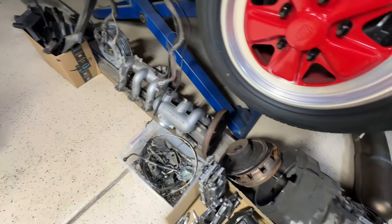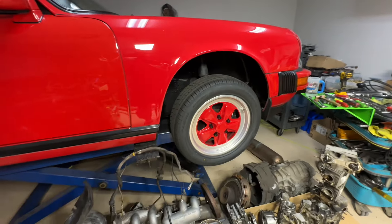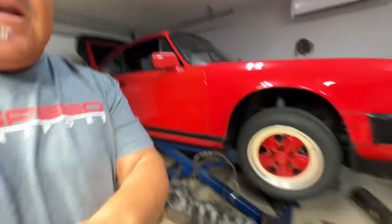So that's the 3.2, and this is going to be a beautiful car when it's all set up and done. I believe we're going to be doing suspension on it too — but for now we're going to do the motor, suspension after. It's very common for them to smoke with bad guides — the valve guides go out, leaks oil, and they smoke. We're only going to do a top end on this, which is fine for this motor. And we've got to add ARP rod bolts and change out these head studs, because the way they're rusty they will fail — they will break next time.